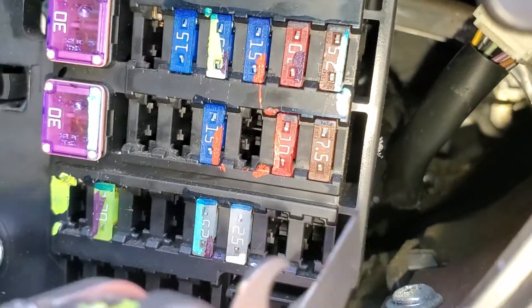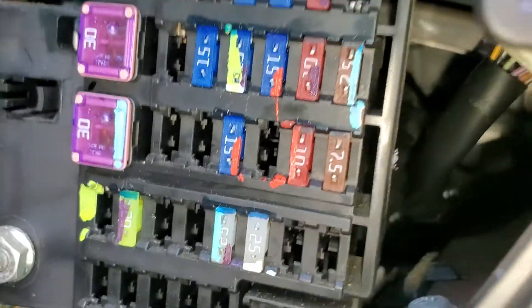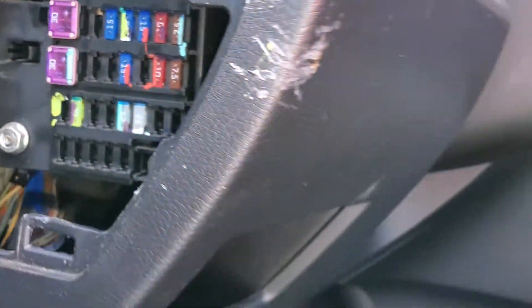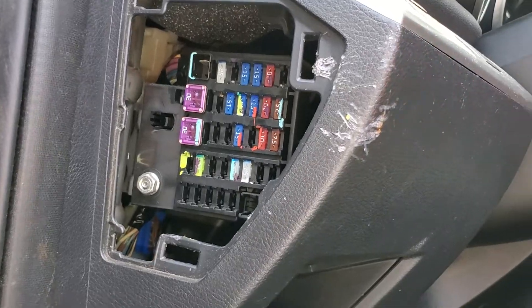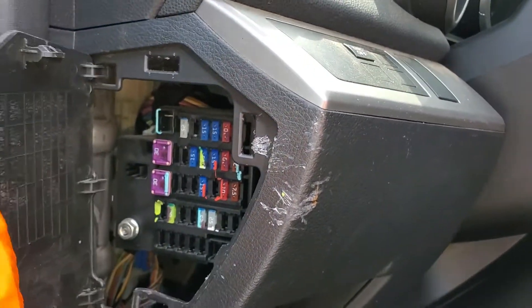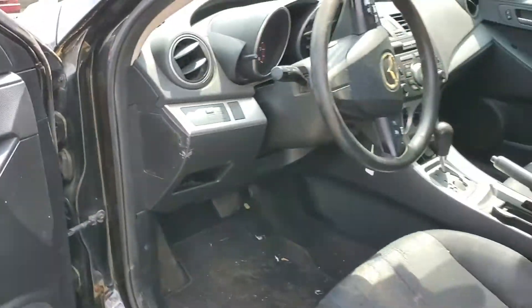You can see the exposed metal on that fuse — you can put a voltmeter there and you should read 12 volts at that fuse whenever the key is turned all the way to start. If you do not see voltage there when the key is turned all the way, then you may have a bad ignition switch. But before you condemn the ignition switch, you need to check the other starter fuse and relay.